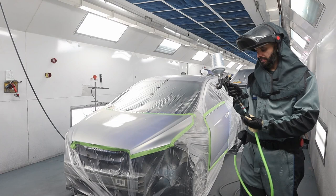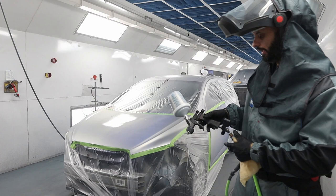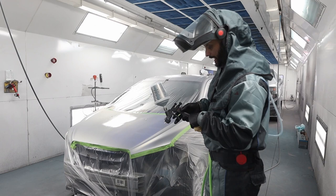Using a wet bed will help with sand piling or protrusion at the end of a blend when you go to clear it. That's one of the most common questions I get — somebody puts a coat of clear on and it looks like sand at the end of the blend. That's your metallics standing up because you didn't use wet bed, or you didn't tack rag. You could do this blend without blender as long as you let it fully dry and then tack rag.